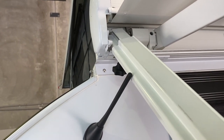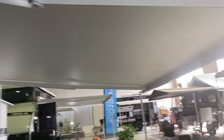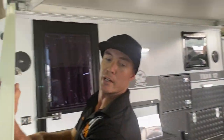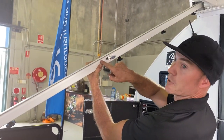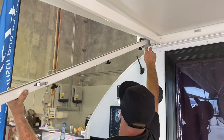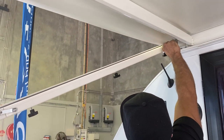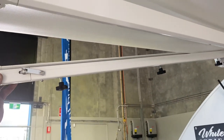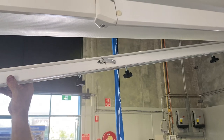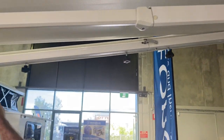You'll notice this piece here — the top jaw — isn't flush up the top; it's actually got enough room so it fits under here without going under the actual roll of the awning. So we want to stay away from that outside edge, yet move up. What I do is come on the inside here and hold it in the middle. By holding it in the middle I'm opening up the mouths, and the awning is durable — you can pull on this — pull it into place and under here. Once it starts to go up, we're staying on the outside of our pole. If it's not going into place straight away, don't worry — we can come back and fix that up after.